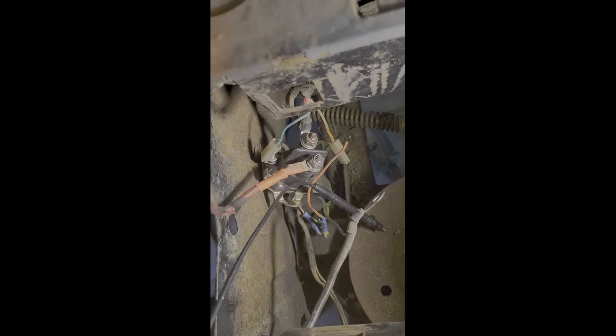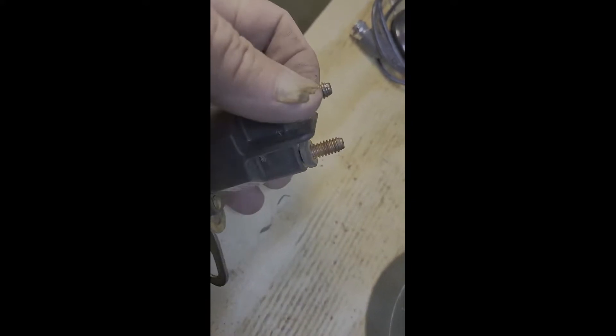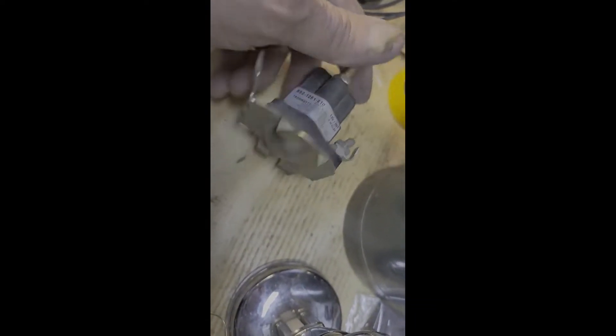There's a multitude of problems here. First, the starter was spinning in the wrong direction — I fixed that. Then I found this cable was burnt almost in two — I fixed that. I tried picking the solenoid and it'll click just a little bit but won't fully engage, even with two batteries. So in addition to the starter spinning backwards and the cable burnt in half, the solenoid is no good. Also, the terminal for the battery is melted, so this thing's been severely overheated. New solenoid on order from Amazon — it'll be here tomorrow.